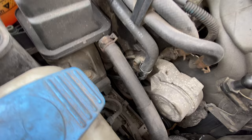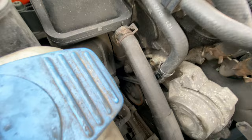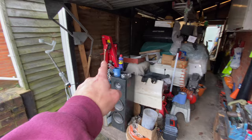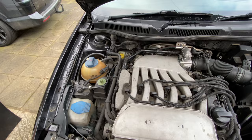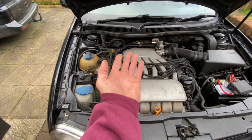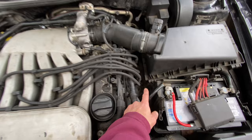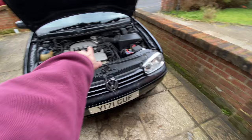Sorry about that — little phone call from my mum. So that's where the water pump is, there's no room to get in there. I'm going to have to raise the engine up and I think to do that I'll use the engine crane I've got right there — just hook it on and take the weight of the engine. People are saying it needs to come up about eight to ten inches, which is a lot. Apparently these engine mounts are okay on this side and you don't have to loosen that one off.